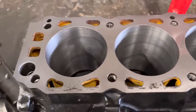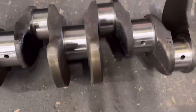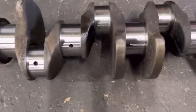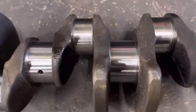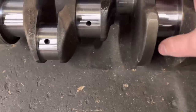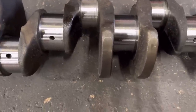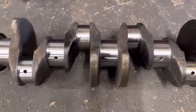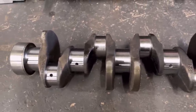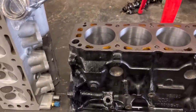Eight thou off the head, so we're going to have to tell James about that. This is the crankshaft — it had gone on one of the ends. First we clock the main to make sure the crank isn't bent. This has obviously been ground 0.25, so John tried to grind the centre main to clean up at 0.5, but there's an area that measures on the diameter about a thou and a half to two thou under bottom limit. That's no good whatsoever. James isn't happy to use a bent crank anyway, so we're not going to use it — he'll try to get a new crank. At least we've rescued the block and head, and that can now go back to him.